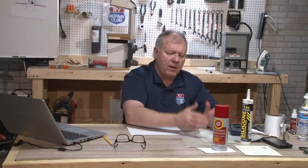The other thing is, is it turning on? It's just not getting cool. And so you should be able to diagnose the fact that, okay, I've got 120-volt power, the circuit breaker is engaged, I have power to the refrigerator, but nothing comes on. Then it's pretty much the monitor board that is the problem. It's not getting to that.